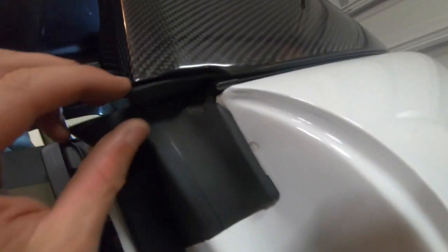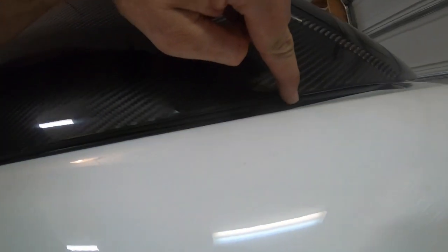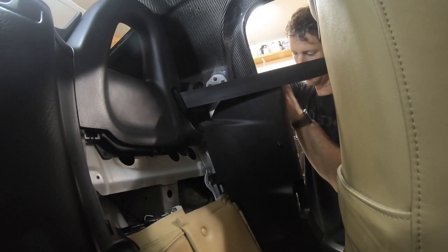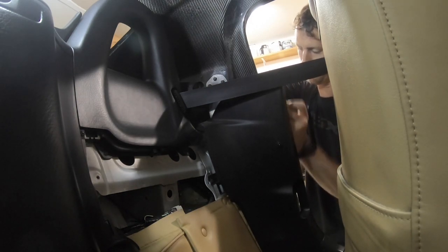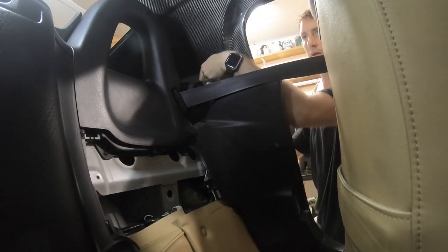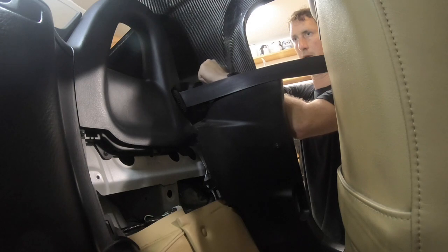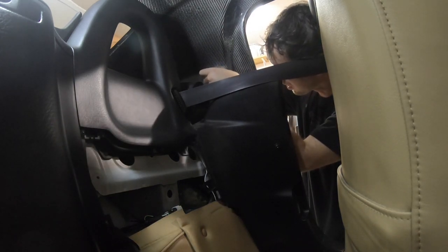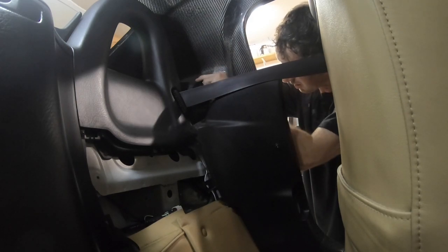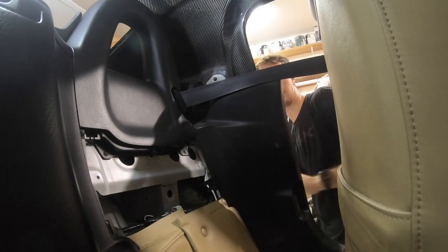So you can see right here, I don't know if you know, it's moving a little bit. There's our seal sitting there too. It's actually perfect the way it sits on that little edge right there. All right, so I'm not sure how much you can see the pressure, but I'm just putting a little pressure from the top. I'm gonna tighten these guys here. First, I do the 12s. A little turn, a little bit of pressure on them again. Not too crazy on these. Okay. And now we're going to repeat that on the other side.